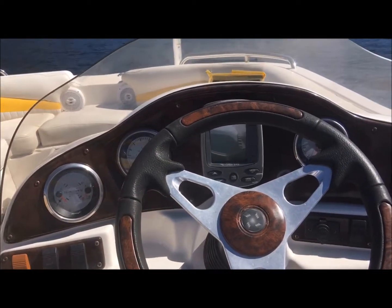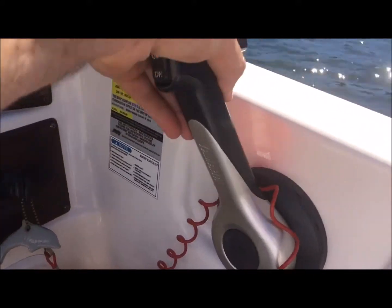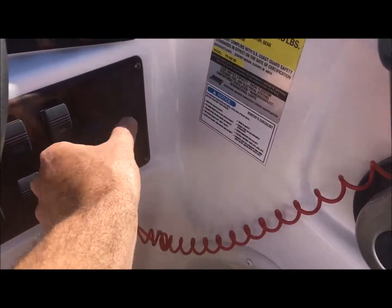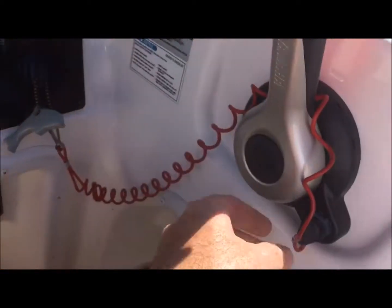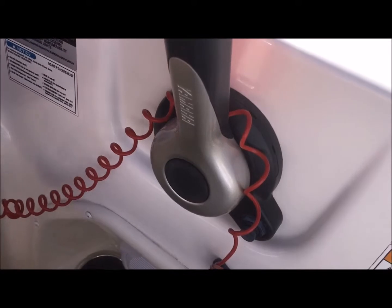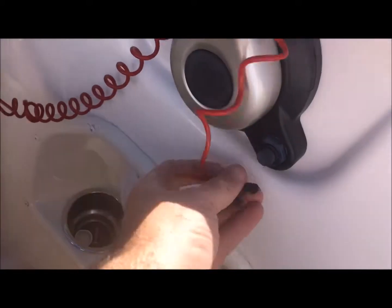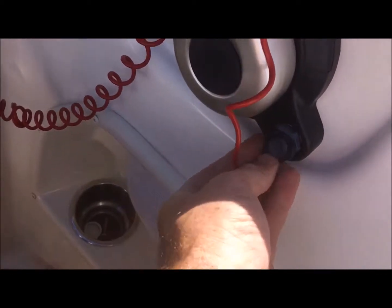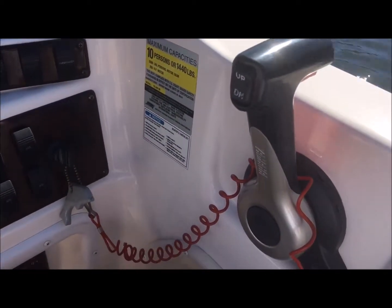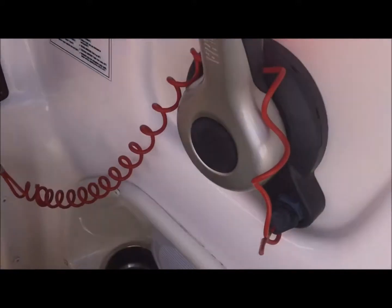Okay, three things that won't start: click, click, click — dead battery. Turn the key over, nothing happens whatsoever. Your battery switch is off, or it's in gear. Let's just put it in gear and watch — nothing, absolutely nothing. If you turn the key and it just turns over and over and won't fire, it's the kill switch — the safety feature. So the three things: click click click is dead battery, key does nothing is in gear or battery switch off, turns over but won't fire is the safety switch.